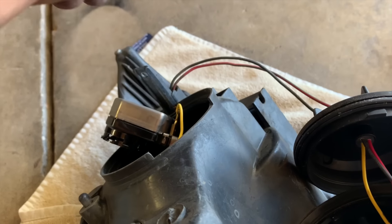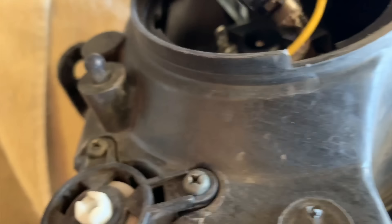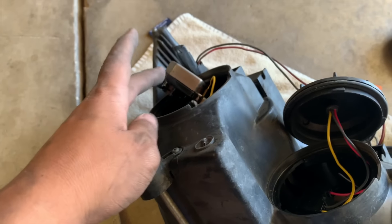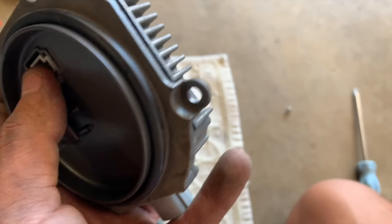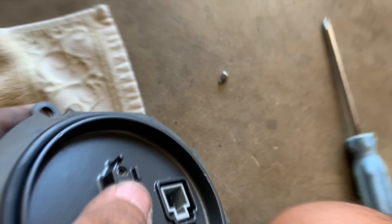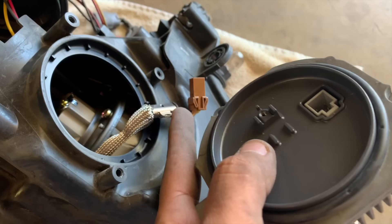Just a quick tip. This is also a twist-and-remove — remove it slowly. Now we've got to take this out to put it into the new headlight. We need this — it was attached here. The sensors are on here and the cable is attached there. There's actually a small bolt that holds it. You've got to unscrew that one so you can take the cable out and then take the sensor out.